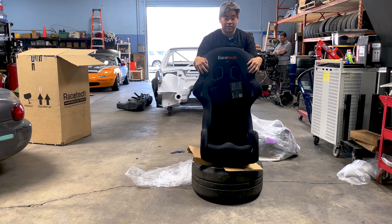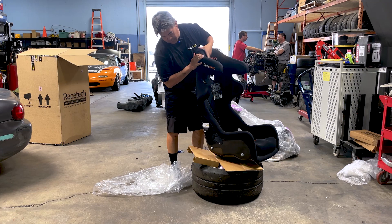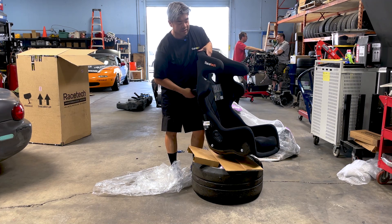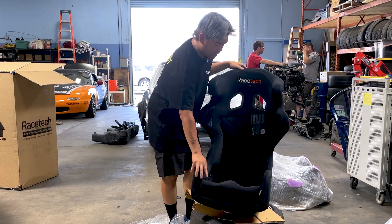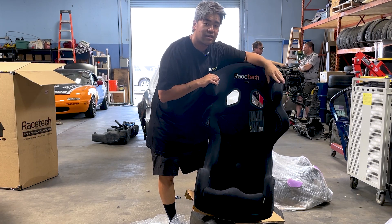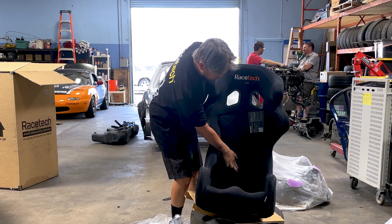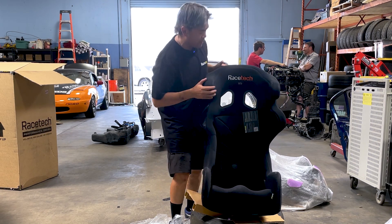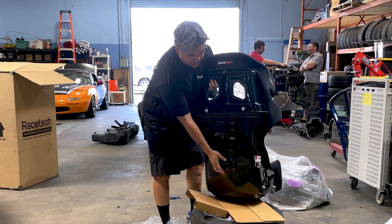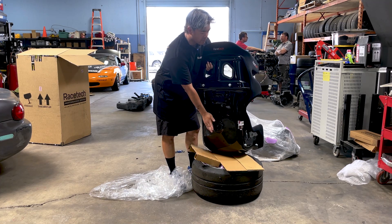So this is the Racetech 119 right here. It comes from Racetech with seat mounting bolts — these are six millimeter Allen sockets. There's a removable seat cushion right here. On all of our cars, we recommend not having it; you sit lower in the car and get a better sense of how the car feels. What's really cool about this back pad — if you notice, it's hollowed out. You can actually put a ram air vent in the back through a NACA duct, or if you have a blower fan, you can feed yourself cool air through the back.